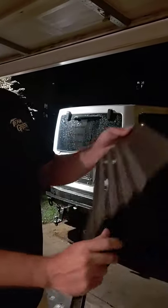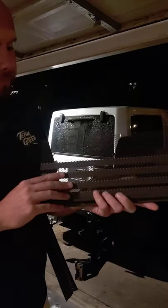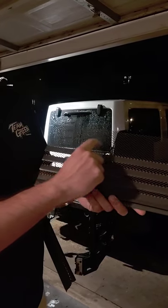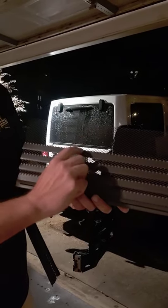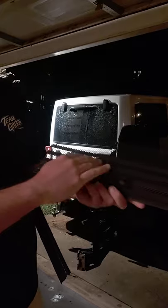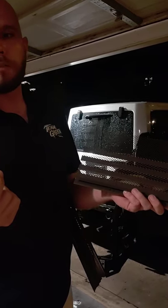Because the expanded metal is a little bit larger, we got some aluminum window screen and I'm going to put it behind the gutter guard — this will be the outside of the window and the finer screen will be behind it. Once that's done, I'm going to round out the corners and trim down a good portion of the open mesh at the top, because if rain is coming down it could get in. I'll trim it down so more of it tucks into the window seal, so the door acts like a shutter for the top.